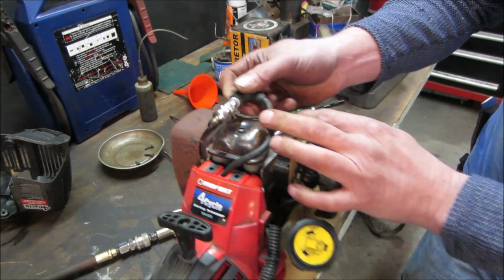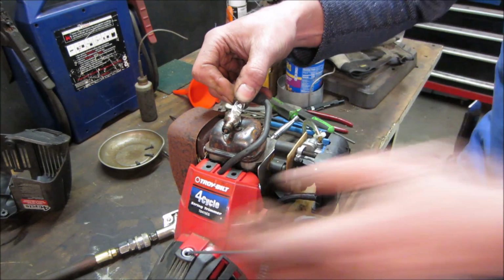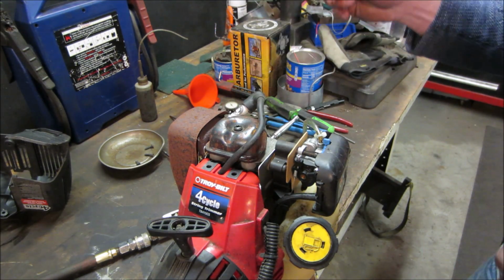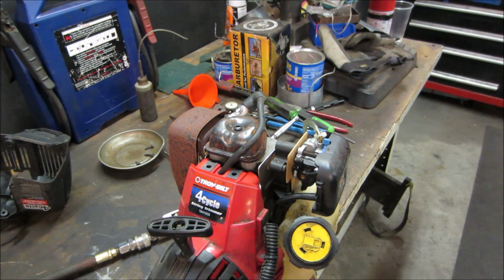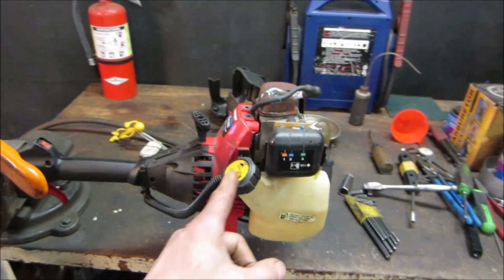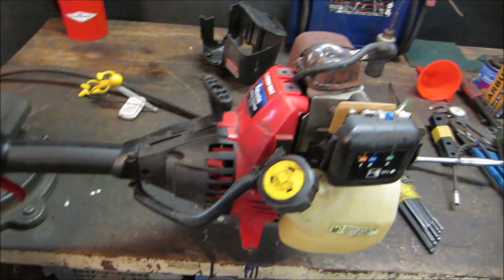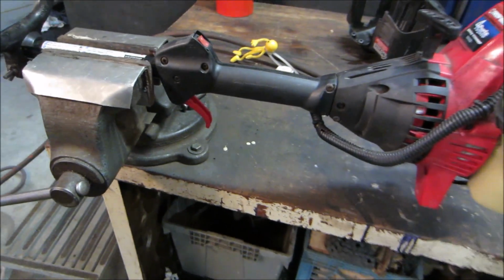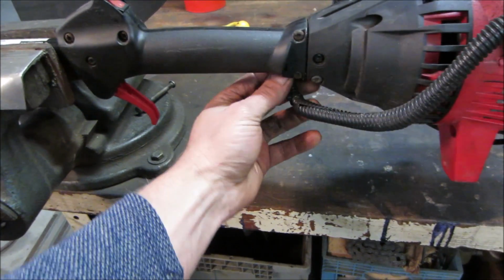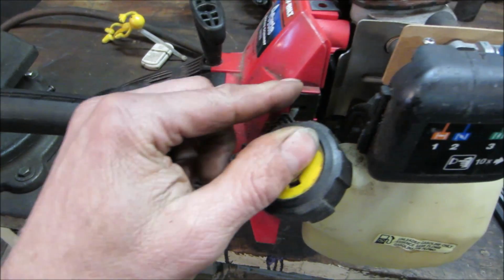And the switch is in the off position. I mean the run position. Oh, that's an issue right there. All right, let's go and see if we have any kind of grounding issue first. So the mag is probably going to be right above this cover right here. But sometimes the wire gets yanked out or grounded out also.